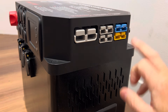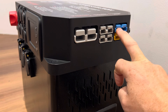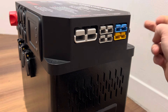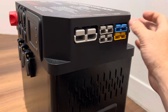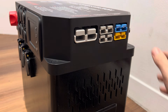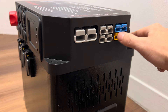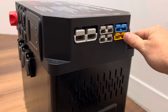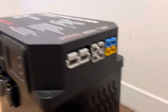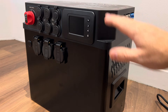There's a solar input and a DC-DC charger, plus a DC-DC accessory power point. There's a built-in DC-DC charger — all you need to do is connect the blue one to the Anderson from your car or hook it into your 12 volt accessory, and it will turn off when the car's off. The solar input has a 40 amp solar charger, so you just plug your solar panels in.